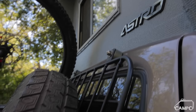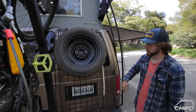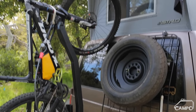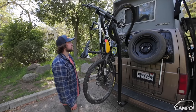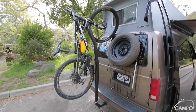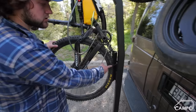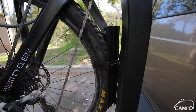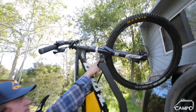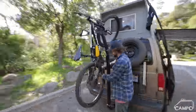I added a rear door rack that came out of a T1N Sprinter van — kinked and bent it to fit the contour of the van, cut out for a handle, and mounted my spare donut there, which I moved to fit the gray water tank. I had some two-inch steel tube that fit perfectly in the hitch, so I made a hangover bike mount for two bikes since I'm getting into mountain biking. I added Thule straps that slide into tracks. I also went to a bike shop, got spare trash tubes, cut them, and wrapped them around so they don't hurt my forks. The rack fits 29-inch wheels.